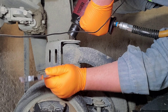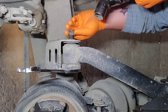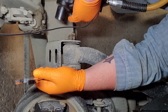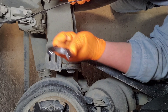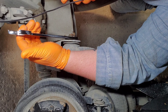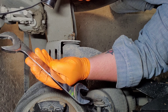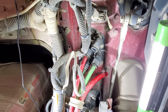As you can see, the wrench didn't slip off at all and the wrench is still in good shape. So Jamie, hopefully that answers your question on if it works with an impact or not. Let's tighten this back on. For holding bolts on suspensions, I think these wrenches are going to work great. If I was to sit here and try to use this to wrench this bolt off, it's not long enough to get a whole lot of leverage. And if I were to put a cheater pipe on here, I would most likely spread the jaws like I did in my failure video on these Tekton wrenches. But that's not really what they're meant for — they're meant to get into tight spaces. So let's go show you how they do on taking off some air fittings.